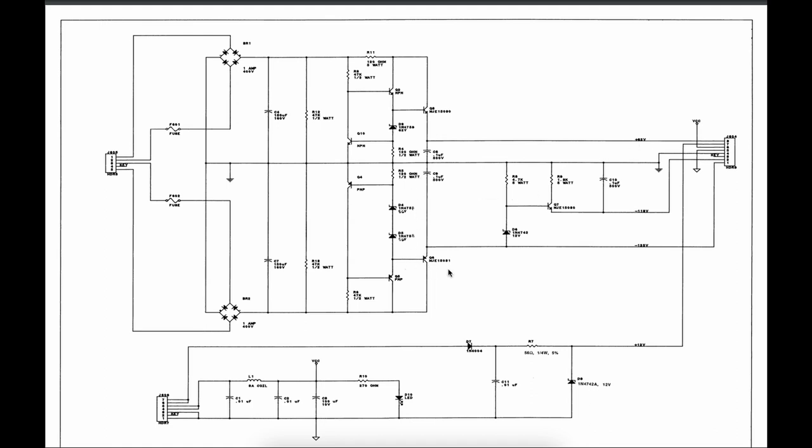So without really knowing what I'm doing, all I'm doing is trying to figure out why you would remove these two fuses, and I think it's just to protect the board. So once we chop these out of the equation, there's no voltage going through here or here, and therefore nothing will actually land anywhere near these plugs with these high voltages, so that when we go to plug it down into our PIN2DMD, there's no high voltages that can just blow things up or burn things out.